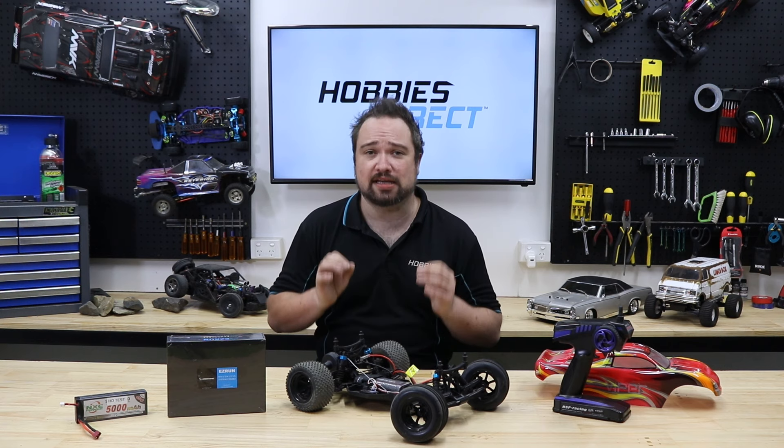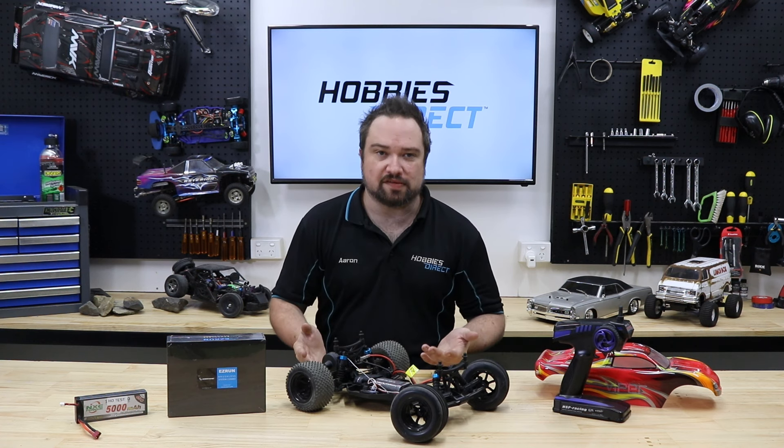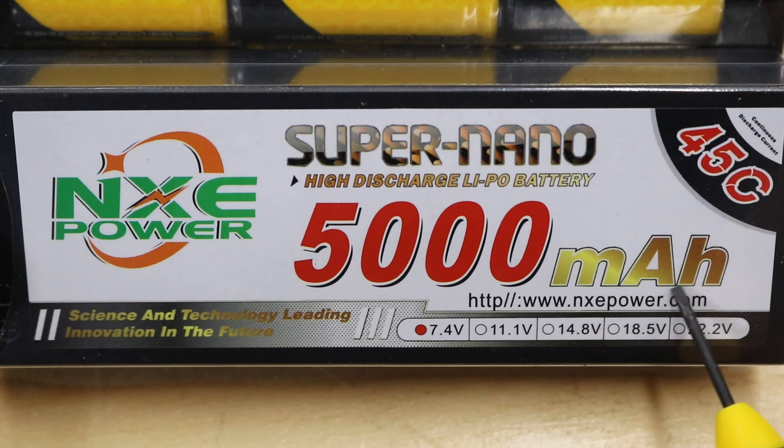This combo is going to be significantly more powerful than the original brushed gear, so your nickel metal battery might struggle to give you decent run times and it'll likely get really hot. What do all these things on the battery mean? Well, the MAH is the battery's capacity — think of it as litres of fuel in the tank. Larger the capacity, longer the runtime. Voltage is how much power and top speed.